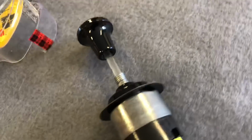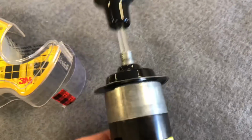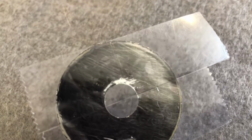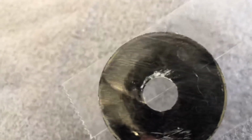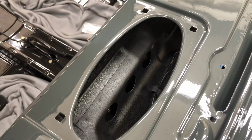So what I'm going to do to stick that back on there, I'm going to use some Scotch two-sided adhesive, stick that on the backside there, stick it on the dashboard, and then run our switch through. So let me go out there, get that adhesive on there, and see what that looks like. So I've got the adhesive stuck on there. What I'm going to do, I'm just going to run a one-sided razor blade around that edge and on the inside, and very carefully, hopefully not damage that foil, and trim off the excess.